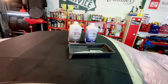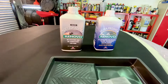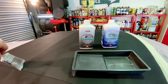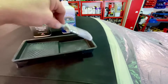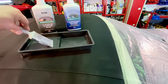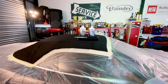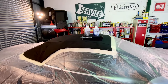These are the dye and waterproof agent products — most people have seen this brand over the years, they've been around a long time. We're using a soft Harris brush; if you use a hard brush it's more likely to flick everywhere. We've got a small roller pot so we can put plenty of dye or waterproofer in there, take the residue off, and apply it evenly. It doesn't really matter how you brush it on as long as you get plenty on. On a big roof like this you'll use quite a bit of the black renovator.